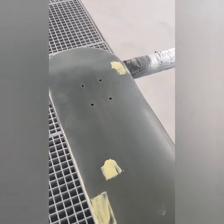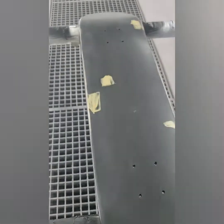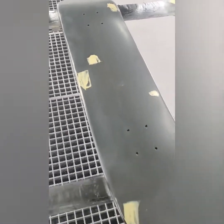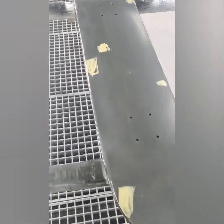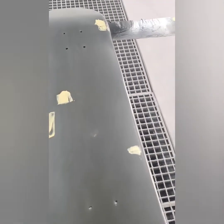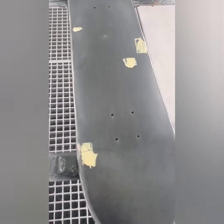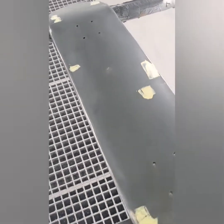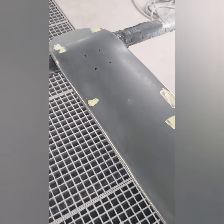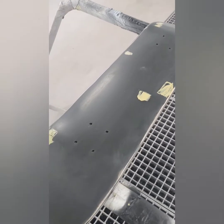So in that case, if you're using something like that as far as with sealer goes, I get some wax and grease remover, and after I bake it, I'll get my DA and some 600 or 400 and I'll spray it down with some wax and grease remover and I'll sand it, and it makes it sand so much easier. You just gotta be careful, because wax and grease dries really quick, so you gotta get all that sludge off before it dries. So you gotta work pretty quick, but it does work really, really well, especially if you're doing a really small spot like I did on this. It would have worked really well, but that's just a little bit of a trick. I like to sand, if I need to, the sealer more than what I do with base coat.